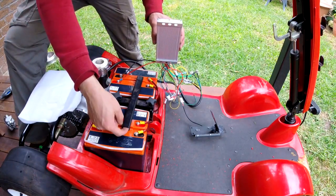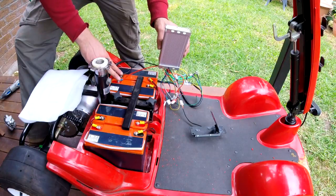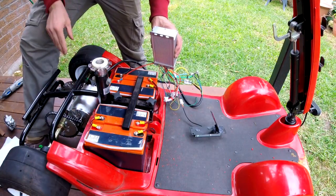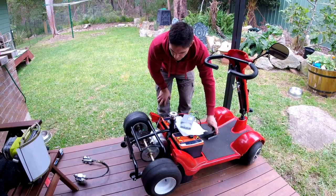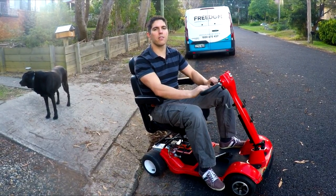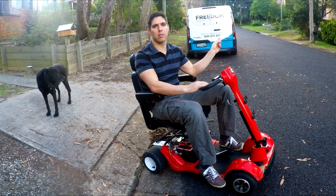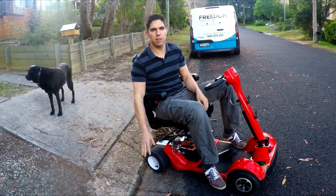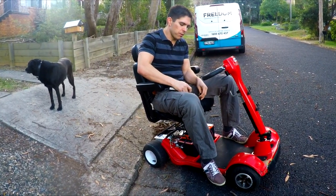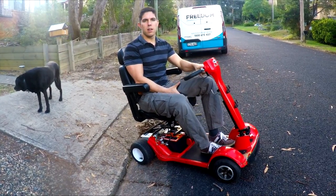I've mounted the battery semi-permanently — I do need to extend this and probably have something that goes over the edge to stop a little bit of wiggle. I've changed the configuration of how they're wired so the two terminals that go to the motor are both on the same end. The speed controller might go nicely somewhere around here — putting it where it is now on this side is where the brake caliper is going to be. I'm ready for the first test drive. There are some very dodgy temporary things, most notably the fact that the brake is not connected. So I'm going to give it throttle uphill so gravity will stop me. I've done the final wiring for the foot throttle — it has a nice waterproof automotive connector, extended long enough to reach down to the final position — but for now I'm just going to use my hand.